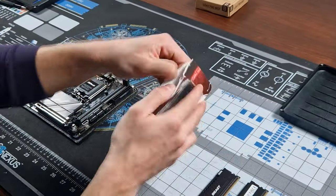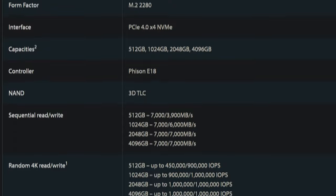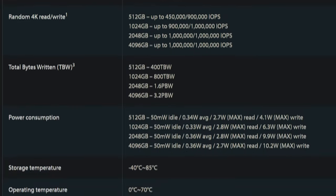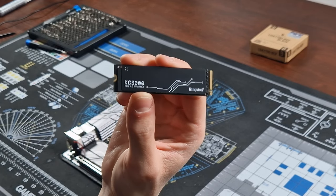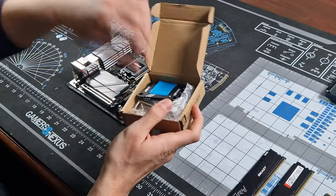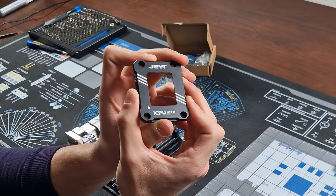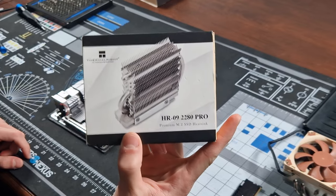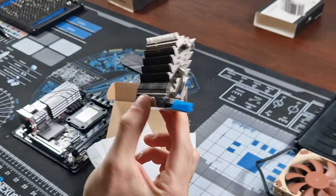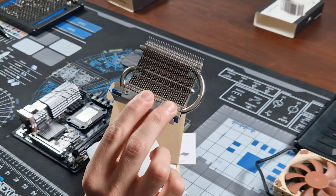For the storage I opted for a 2TB Kingston KC3000, which is a Gen 4 NVMe drive that offers impressive speed for its price point. I plan to install Windows on this drive while using my other 2TB ADATA NVMe SSD for storing video files and games. To maximize thermal transfer I need to use a correction frame which helps with cooler contact. For the NVMe SSDs I bought heavy-duty heatsinks from ThermalRite, which will help maintain the SSDs at acceptable temperatures without any airflow.